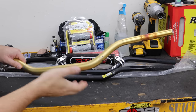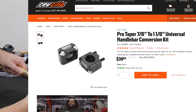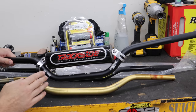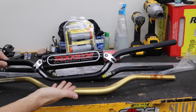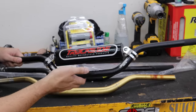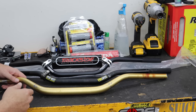To run a fat bar you'd have to use riser adapters, since the lower part of our risers are built into the triples. The other option is to stick with the seven-eighths design, which is the same size all the way through. I always said these weren't as strong, but several people have argued that having the crossbar through the middle actually makes them even stronger. The point is they're all stronger than stock.